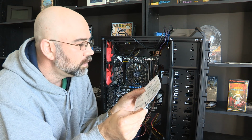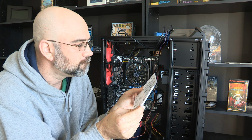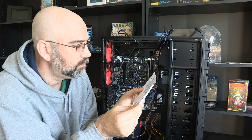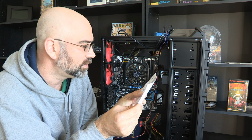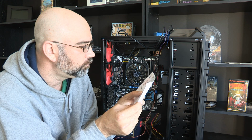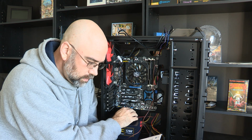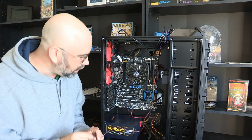Okay, power switch. Now, power LED, there is on and off. On and off. Interesting. Chassis ground, front panel audio. Okay, well, it looks like the on and off switch is going to be power. It's got to be power. And so, okay, on and off is the red ones on the connectors down here. This one's right down in here. And so, okay, and I don't think that it's polarized. I think it's just a loop, so it doesn't matter which way it's plugged in.